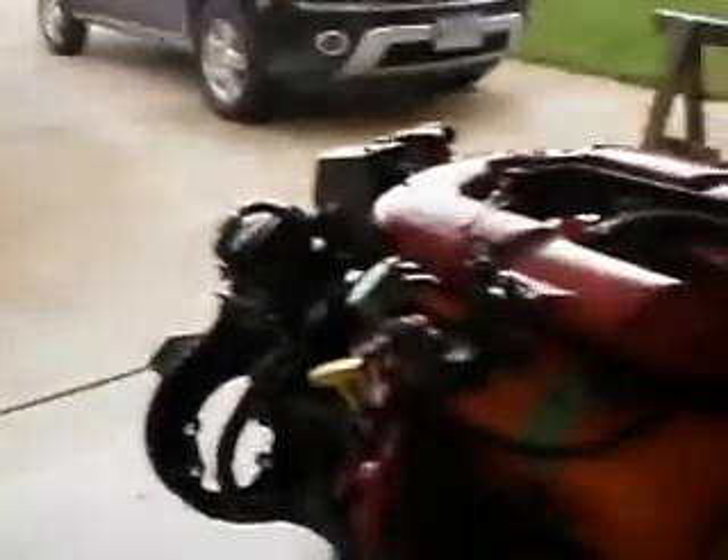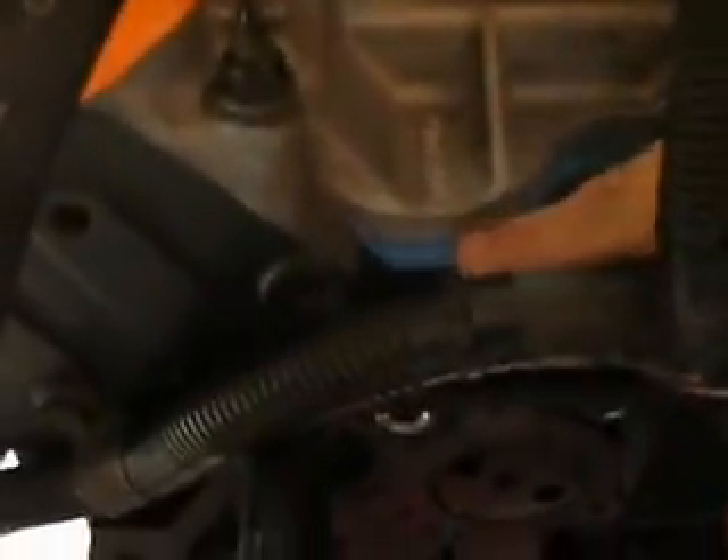This is pretty much what we're looking at. I'm going to take a little video of the engine in there running. This is exactly where it's leaking out of right now. This whole seam along here is where it's just puking oil out the back. It hits the headers, hits the cat, and once it drips down the headers it just smokes and smells. You've got to fill it up about every week with oil just to make sure it's topped up.